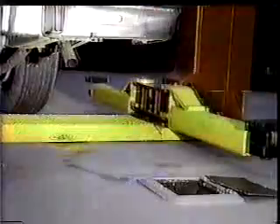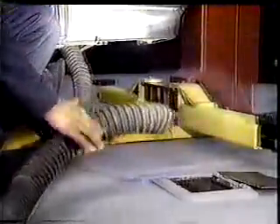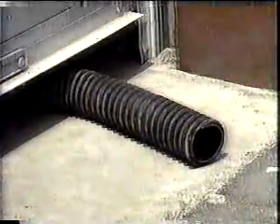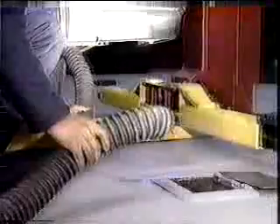It's often necessary that an engine be started while a car is in the shop, and this can be very dangerous. A running engine produces carbon monoxide. You may not see it or smell it, but inside a closed shop this poisonous gas can kill you. Therefore, never work on a running car without proper ventilation. Some shops have a floor ventilation system where a hose is connected to the car's tailpipe, and carbon monoxide flows through the hose into a floor vent and out of the shop. Some mechanics will run a hose directly out the shop door. However it is done, make sure carbon monoxide is removed from the shop.